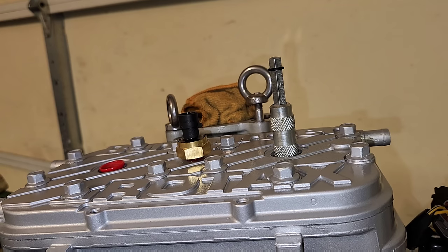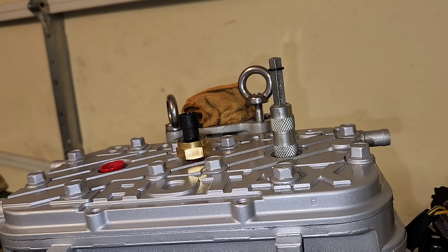This tool is really cool. You can actually get a set of them that has pretty much three different spark plug thread openings. I found it really useful just for this main purpose — you're not sticking a screwdriver on top of a piston or a ratchet extension or whatever. This tool really makes it a lot easier where you're not sitting there trying to guess. It actually gives you markings that you can work with, making it a lot easier to see where you need to stop to get the most accurate reading. Hopefully that helps you out, but I'm going to keep on going with this rotary valve timing to get you the most information you can.